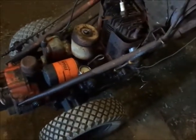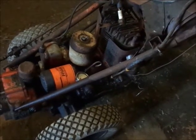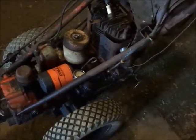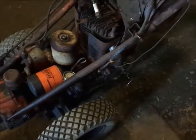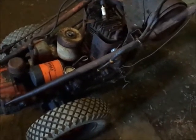If not, I have a sneaking suspicion that either the cylinder head doesn't have a good connection to the jug, or there's no ground path through the transmission into the aluminum case. I'm gonna have to take the governor bracket off anyhow, so I can clean up those bolts and put them back in and see what that does. And we'll go from there.